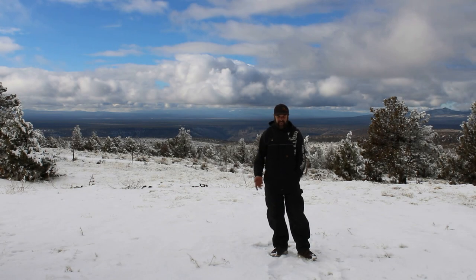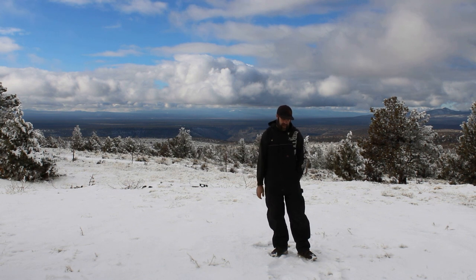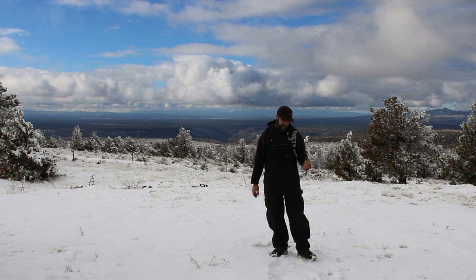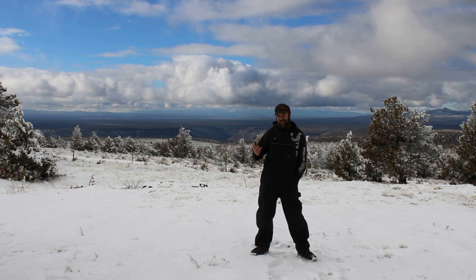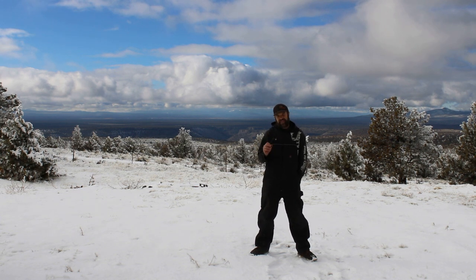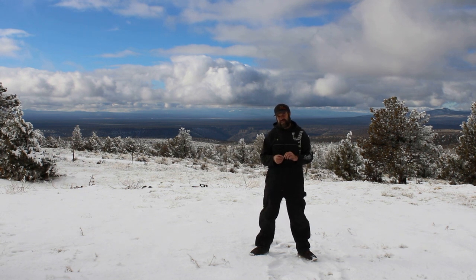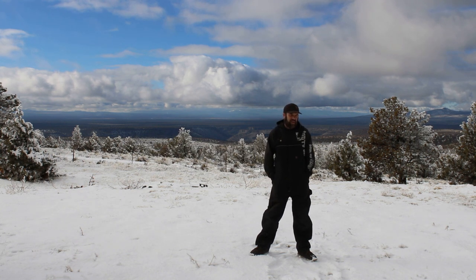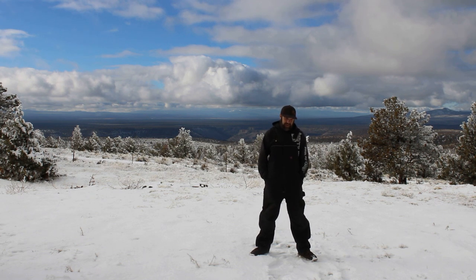I think the results are pretty clear in the video and the pictures — it cleans pretty darn good. I did use a toothbrush, one that I don't use anymore, and did a little bit of surface cleaning on the outside when I pulled them out of the cleaner after soaking for 15 minutes, just to agitate the outside. Then I washed them off with hot water, blew them out, and reassembled them. I did notice that the float tab, the seat for the needle, and a couple little things did darken. A guy could probably take some 4-0 steel wool and clean those back up shiny if you need it that perfect, but all in all it worked really good and it didn't seem to darken the carburetor body.